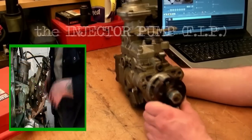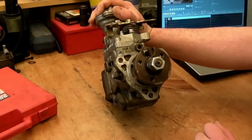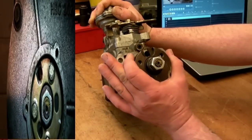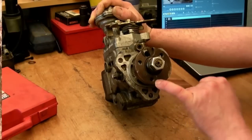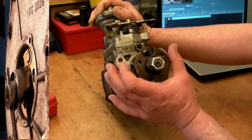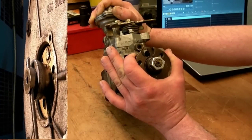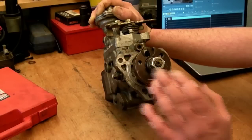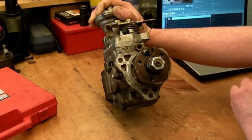The injector pump — this is a Bosch VE type — is fixed to the rear of the timing case cover. It has a drive here which is bolted to the internals of the pump, which in turn is bolted to the pulley wheel. You can slacken these three bolts off, which allows you to turn the pumping gear to reset the timing or perform a simple check, but you need to have the engine timed first. The 200 and 300 TDIs are exactly the same — they use the same pin and the same three bolts, although the pump looks slightly different between the two types.